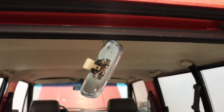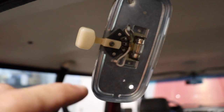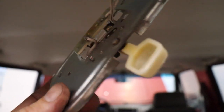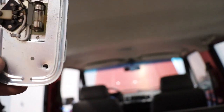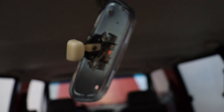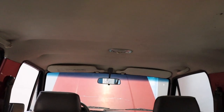The Trooper's interior lights have always befuddled me. No matter what I've done — bulbs, all that kind of stuff — I never could get connectivity, any wire readings, any 12-volt readings, until I cleaned all the connections. More importantly, the ones on the back of the circuit board. Cleaning up those solders with a wire brush. And now it works on the door-open position — you can see it's illuminated. If I push the little rear door button, off it goes. So now our Trooper has at least the rear one working. Time to move up and do the one in the cabin.